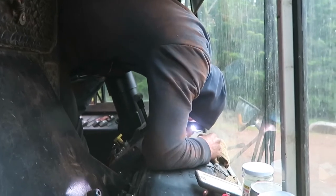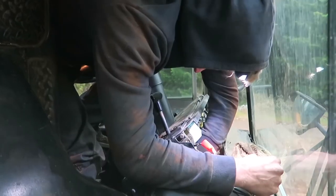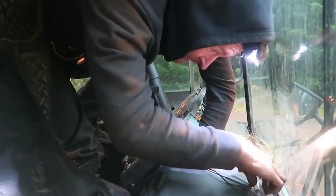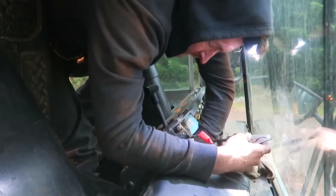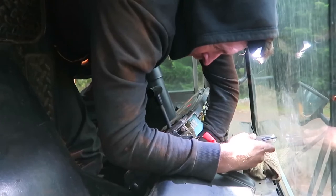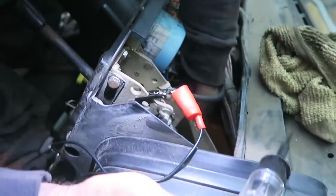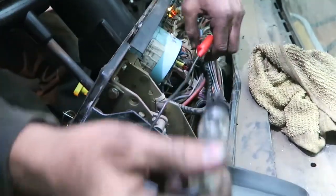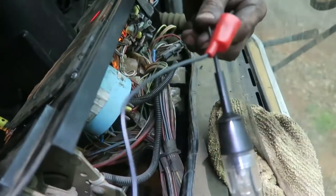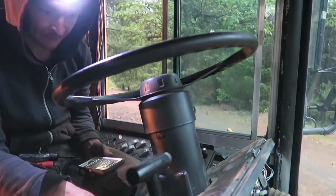What I'm doing now is trying to figure out which wire is the starter wire. I think there are five wires that come off the back of the ignition. The starter wire is going to be the one that won't light up the tester on its own, but will light up when I turn the key with the tester on it. It's the purple wire — the purple one is the start wire. I just put the ground clip on ground, stab this point through the wire, and that gives me the reading. The purple wire is confirmed as the start wire, which means the ignition switch is working.